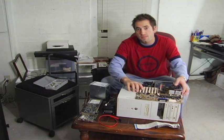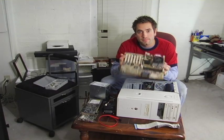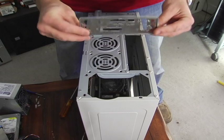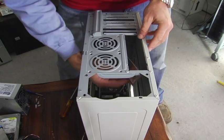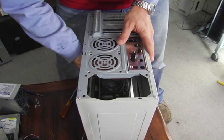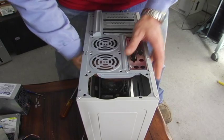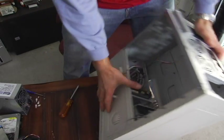Hello, I am Gary Malek and in this video I am going to show you how to install a motherboard. Most likely your motherboard will come with an adapter plate like this. You take this and install it in this hole here so there are no empty spaces. This is designed for your motherboard specifically, so make sure you use the right one and not just one you have laying around. Then you put your motherboard in.